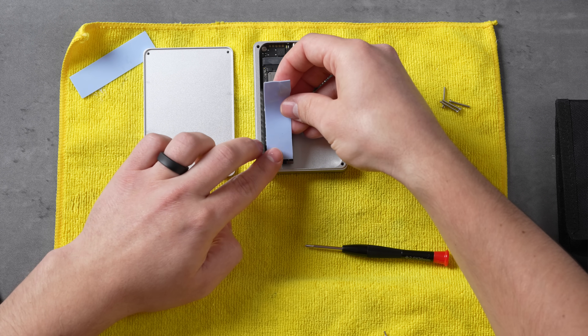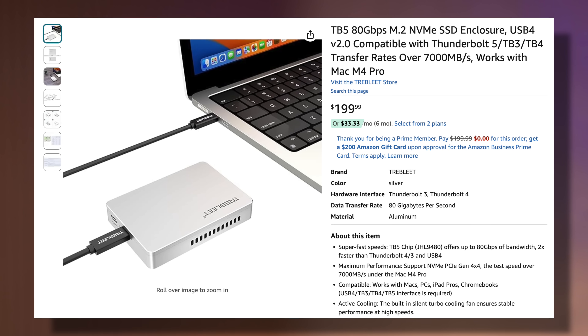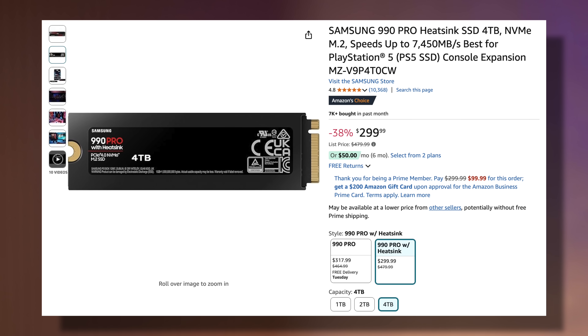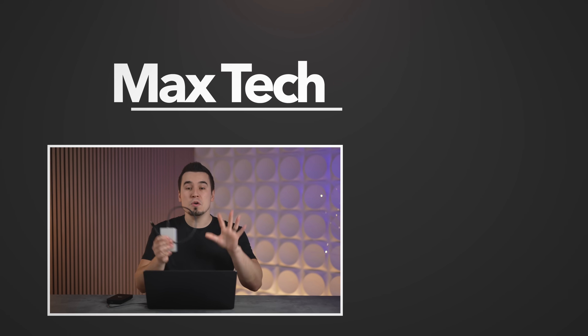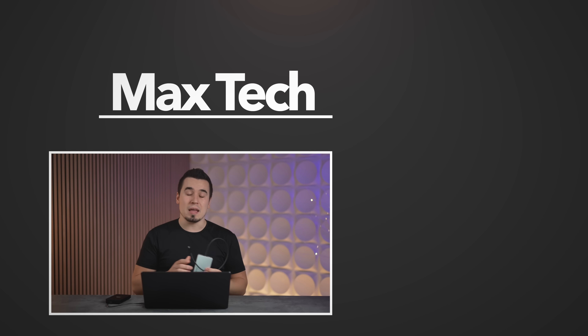The resale value of built-in storage is gone when you sell — but this external SSD you keep no matter what machine you have. Format it as exFAT and it works with both Mac and Windows PCs. We just built a killer DIY SSD for $500 — $200 for the Trebleet enclosure and $300 for the Samsung 990 Pro. Links to the enclosure and all SSD sizes are in the description. Save yourself money, don't pay Apple's prices!